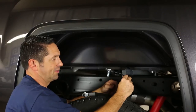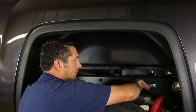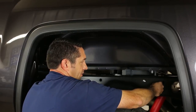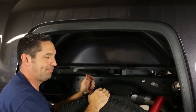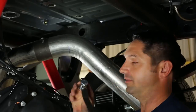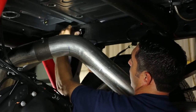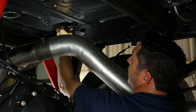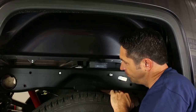Now we're going to install the bolt guides. The short ones are the easiest — simply put them inside the large slotted hole in the frame and rotate the bolt into position, pulling it in flat. For the driver's side, install the long bolt guides from inside the vehicle frame using the large hole in the frame right above the bump stop. Insert the bolt and strap, then pull it up to get the bolt into the best position accessible from the outside of the vehicle.